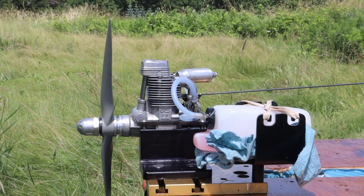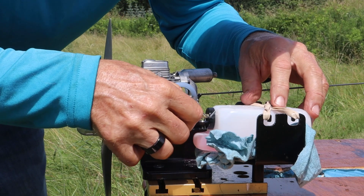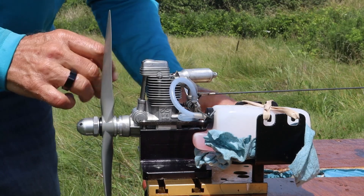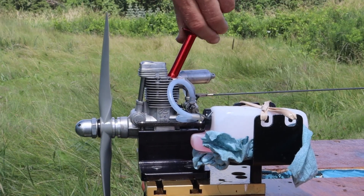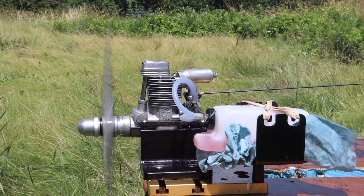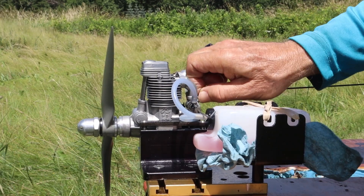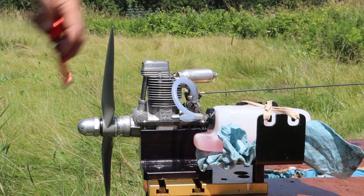So I've reversed the starter now. I know which way is full throttle, I think. Let me try this again. So full throttle is this way for choking. We'll fire this engine up and see if it needs any kind of tuning at all. I'm supposed to start it at full throttle. It seems like I don't have my throttle stop set properly — I could have sworn I checked that, but maybe not.